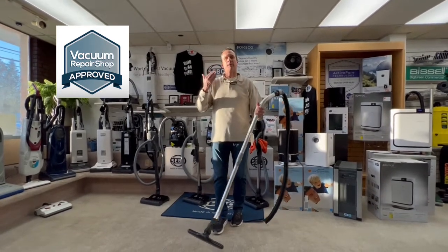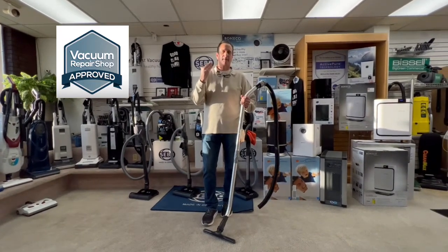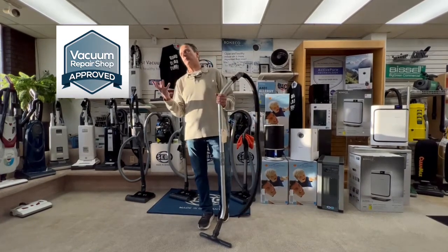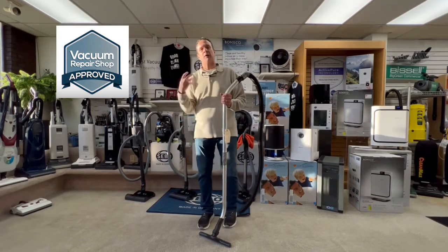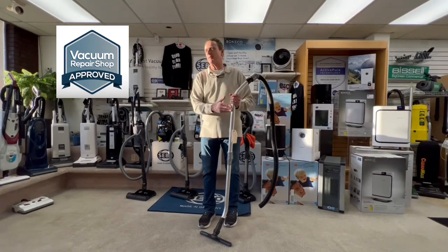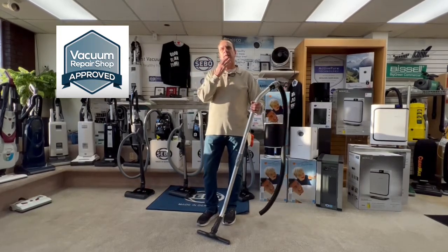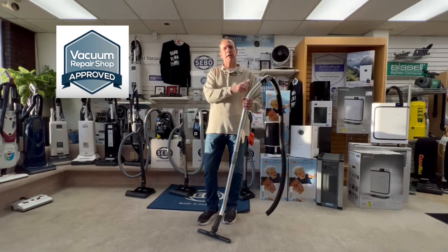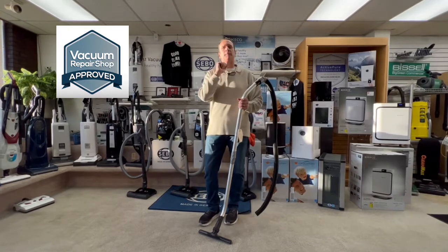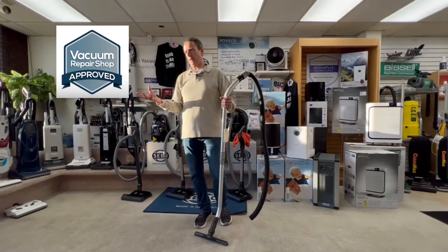Knowing the problems that people have with backpacks, I made a recommendation to him. We have a much lighter weight backpack than what's out there. Most backpacks, while the concept and the idea is really good, create problems for people. They're kind of heavy. They also require a specific set of attachments, commercial grade backpack attachments, and specific brand attachments. Generally, there's no power nozzle, so they're not great with carpet. They're good for bare floors or low nap carpet, but they don't clean the carpet too well.